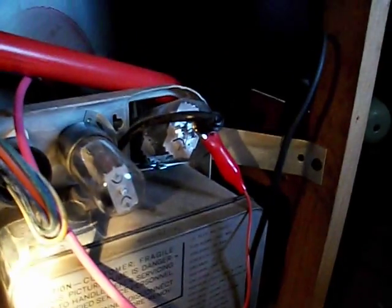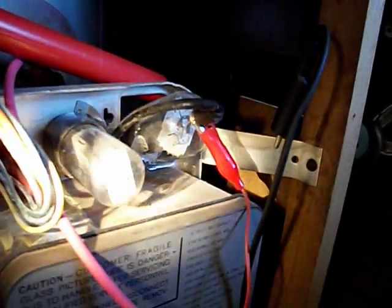Here's the setup. I've pulled the cap up enough to where it's still hooked up to the horizontal output. This red lead goes to the tripler's input pin, and the black one goes to what's called the reference lead, which is connected to chassis ground.